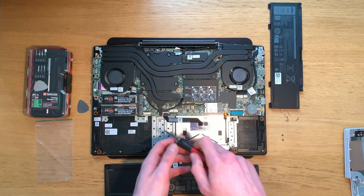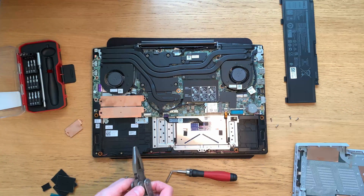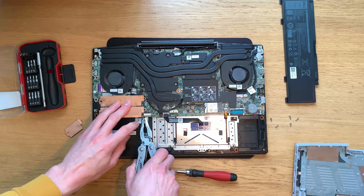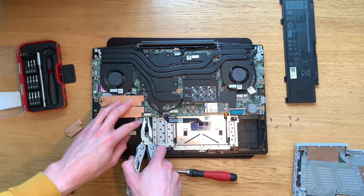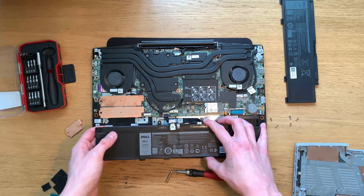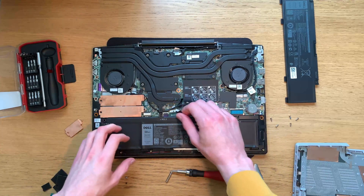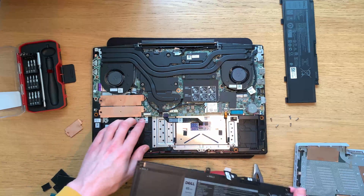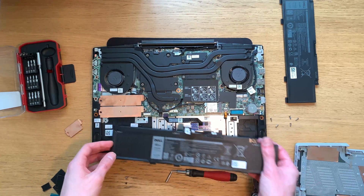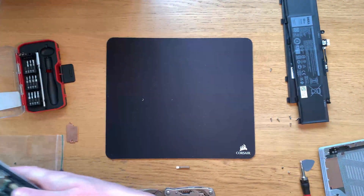With this new battery we need to remove this screw from the heatsink. I got totally frustrated with it by this point and I ended up taking a pair of pliers to the standoff and literally ripping it out of the base plate. Honestly I can't think of another way that this could have been done, but I'm no expert. This most likely will have voided any warranty that the laptop had. While pulling the standoff out I also broke the two plastic rivets holding this part of the base plate in, but what's more concerning is it also sent bits of metal flying around the place, so I had to make sure that I retrieved all of these before I turned the laptop back on, else risk creating a short in the laptop which would have been very bad news.